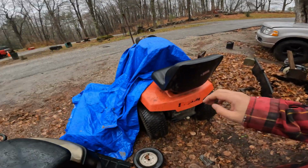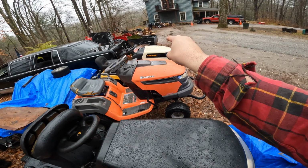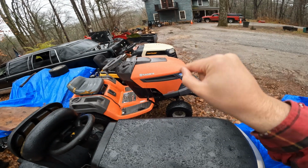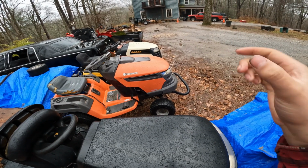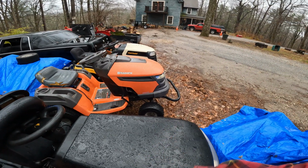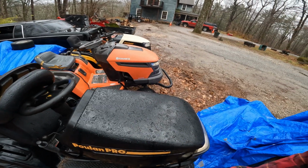I've been working really hard with these mowers, and so far they've been giving me nothing but good things, except for Leroy here. Electric's been a bit of a hassle, but we got her done. Apart from that, we're going to tune up the Husqvarna in today's video, and then the Cub Cadet, I may not make a video on it, or I may, I don't know. I've got to tighten the valves on it and give it an oil change because it's begging for it right now. I have to give this one an oil change too, but it's not as bad as the Cub Cadet. The Cub Cadet's so bad that it actually has a hard time starting. That's how loose the rocker arms are, and I don't want to blow another motor, so we're going to tighten those up, and I already have the tools for it. I just have to get the Husqvarna in first. So that's today's video.